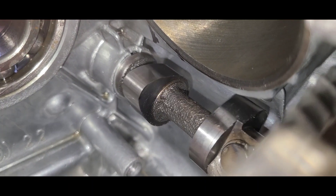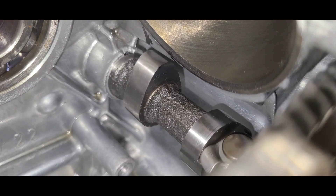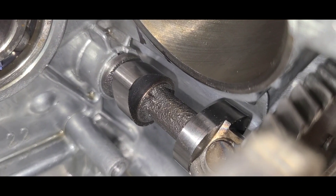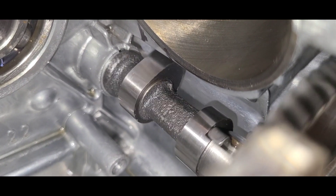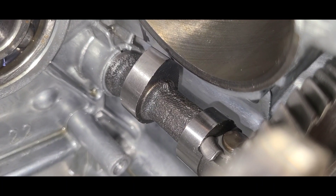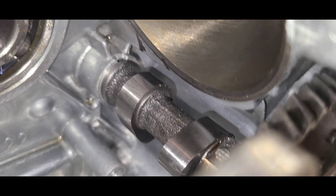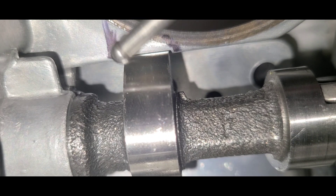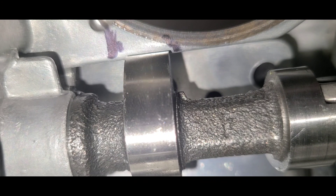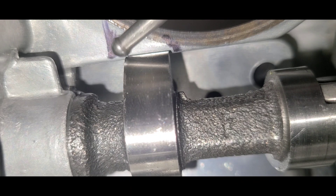Now let's take a look over here at the intake. Turn it — see, we're hitting. I'll roll it around, make sure it's all the way in the journal, and I'm hitting again. Those two marks that I made — going in one and two — those are reference points marking the edge of the intake cam lobe.